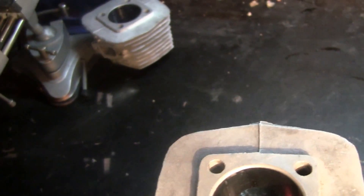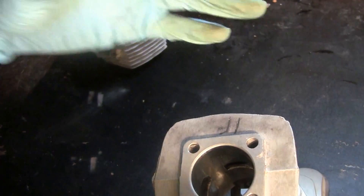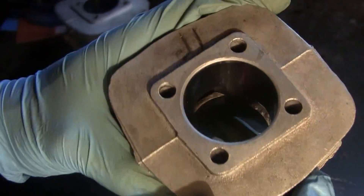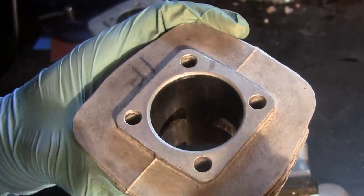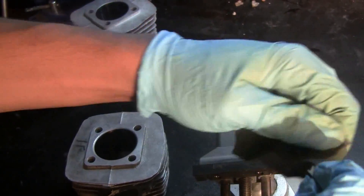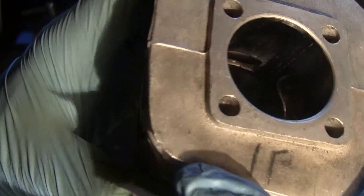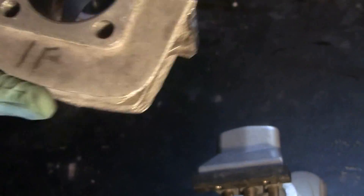The last aspect I want to cover is cleanup. After you're done working on all the ports, it's really important that you chamfer everything — round all edges on all ports. This is important because you don't want your piston rings getting caught on any burrs. One way to do this is with really fine sandpaper — go over the edges from the inside and give each edge a chamfer on the inside, making sure there aren't any burrs for the rings to get hooked on. Make sure all edges are filed down — it's extremely important.